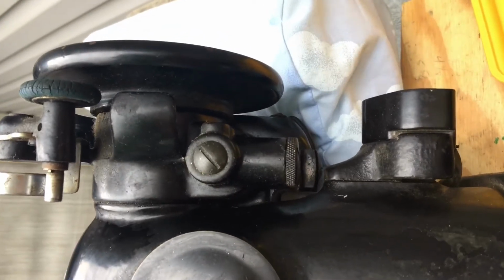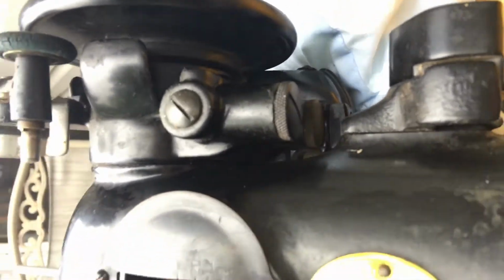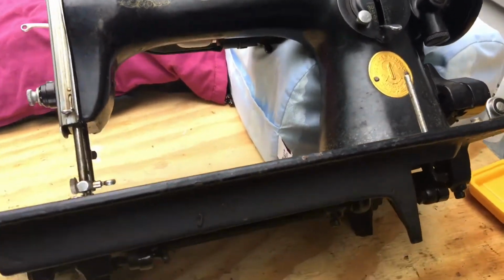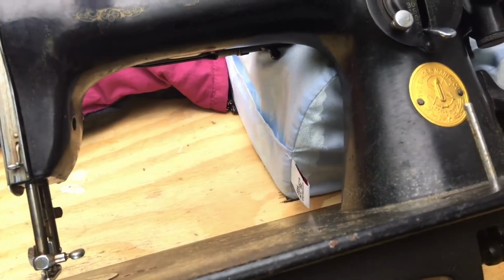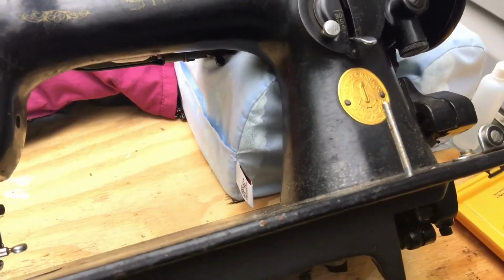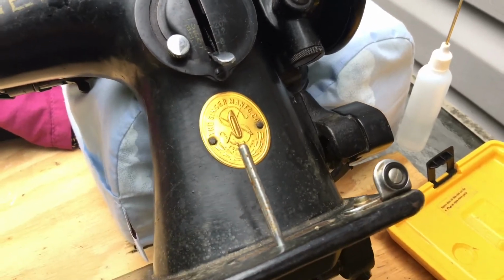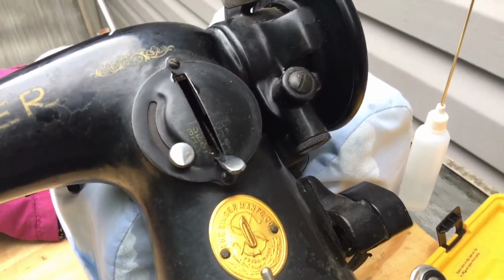So anyway, one of the ways you'll know a direct drive motor, other than the little pot shape in the back, is these little access ports for the grease wicks right down here. This motor design had a lubrication system that involved grease wicks, which works really well. But it probably hasn't been overhauled ever. It was designed to be, though. That's the beauty of these things. They were designed to, on occasion, be serviced.